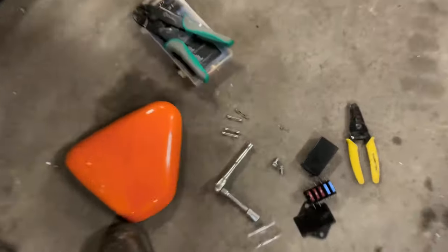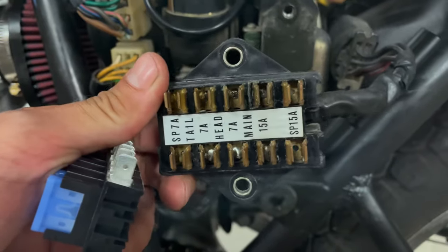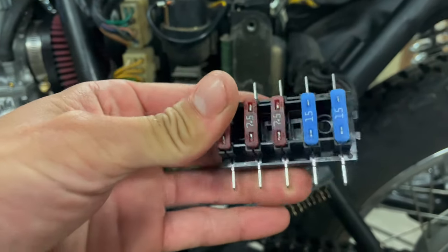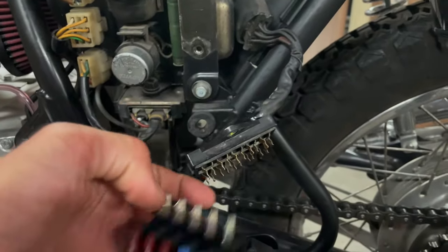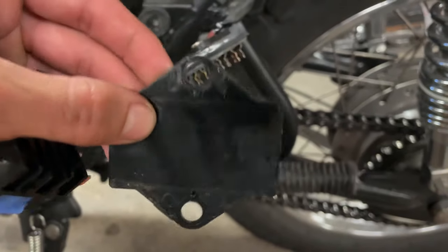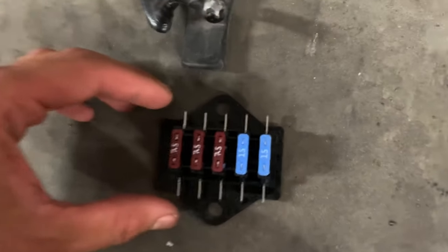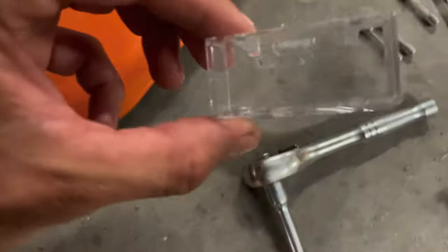So that's what I'm addressing today. I got this ATO-style fuse block from O'Reilly's and I think it's going to work out perfect — it's got five inputs/outputs, just like the factory fuse block, so I'll be able to have a spare 15 and 7.5-amp fuse. I'm replacing the old fuse block with this new one. The back side of the OEM fuse block just pops off, and I think I'll epoxy the new one onto the back of that so I can bolt it up in the factory location. I'll probably peel the sticker off the old one and place it on the cover of the new fuse block.